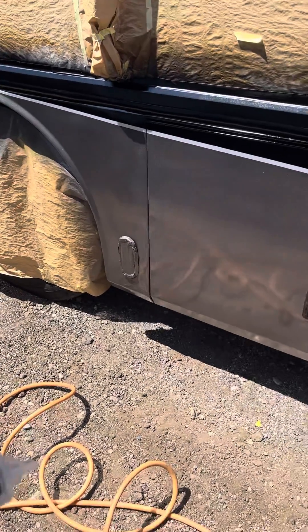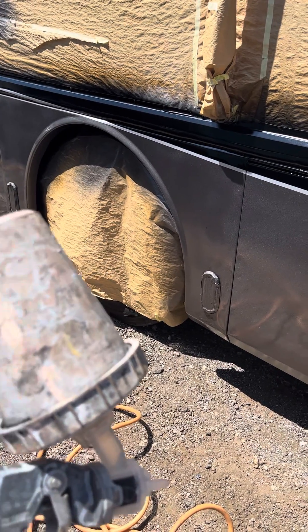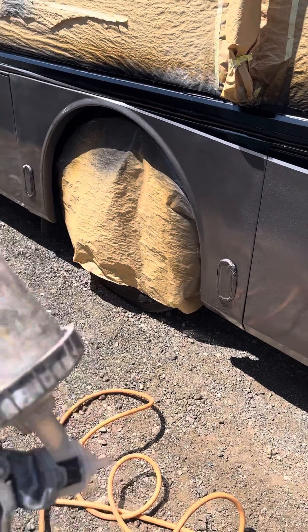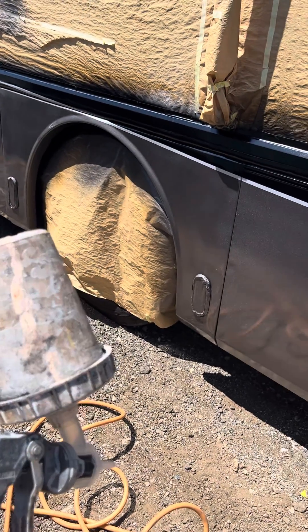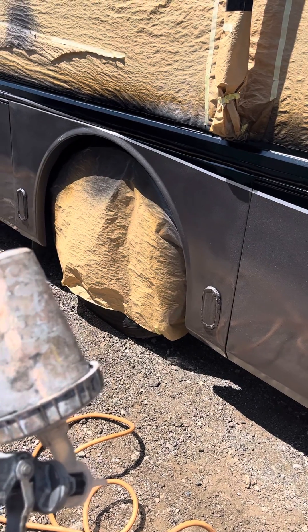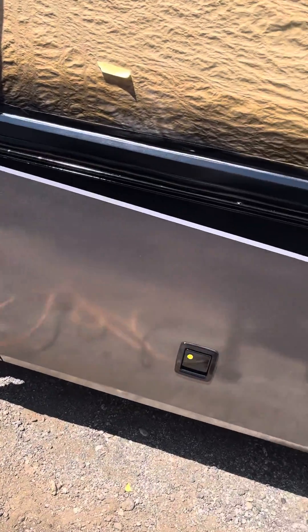So it's even more — 60 to 70% on the first pass. The reason I do that is so the atomization is so tiny that you don't get fisheye, and not only that, you don't get too-big splatters. They're real small, real fine splatters, as you can see — just real fine.